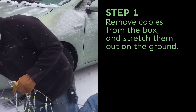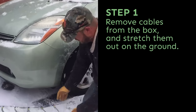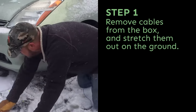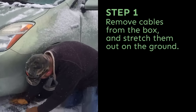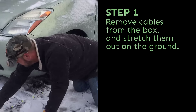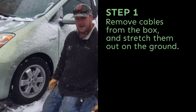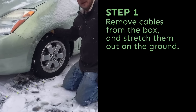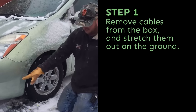On a front wheel drive, lay these out on the ground in front of the tire and you really just want to be in the middle, centered. Put it out in front, then pull the vehicle up on top of the tire chain so it's pretty much right in the middle. As long as you've got room to get your hands in the wheel well to connect them, just go middle and middle.